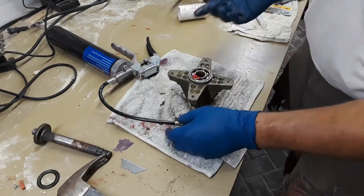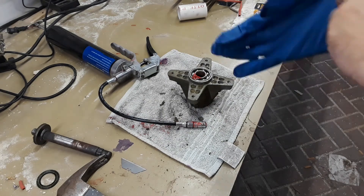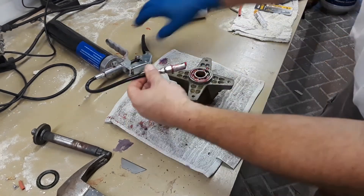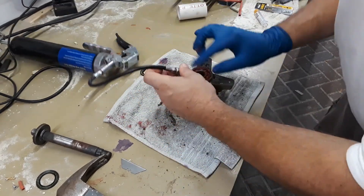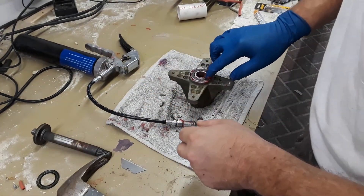This is about 50 hours on the mower and I realize I'm basically packing new grease in over old grease. At around 200 hours I'll take these bearings out completely, take the seals off both sides, and purge the grease — essentially meaning push grease through one side until all the old grease gets pushed out the other side.